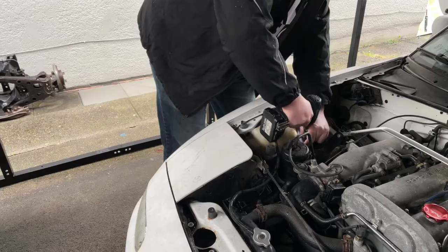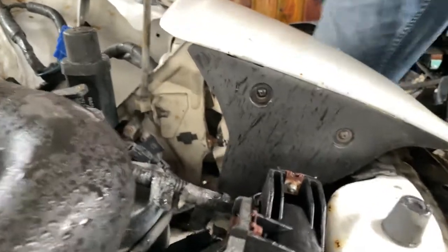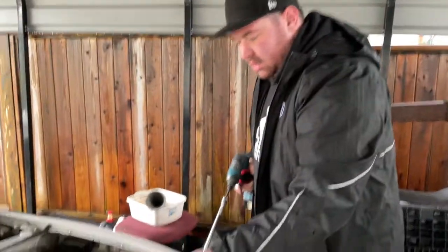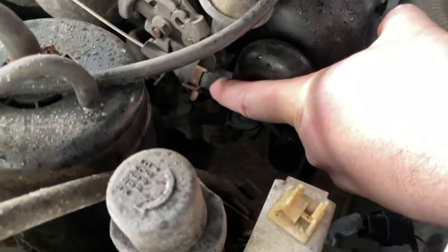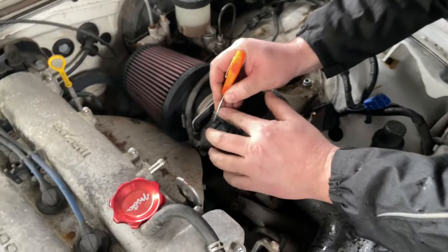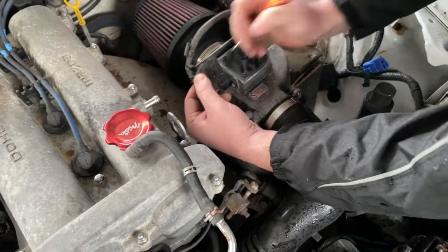I'm going to take the hood prop rod right out. Once the clip is undone, fold this side out and then slide the rod right out of the clip. Next I'll take the air intake off as a complete unit — there's a clamp down underneath the throttle body, and that goes to the idle air control. Disconnect your mass air flow meter wiring harness connector; there's a metal spring clip that goes all the way around. Just pop it off on both sides loosely and you can pull the connector off, then push them back together so you don't lose that spring clip.